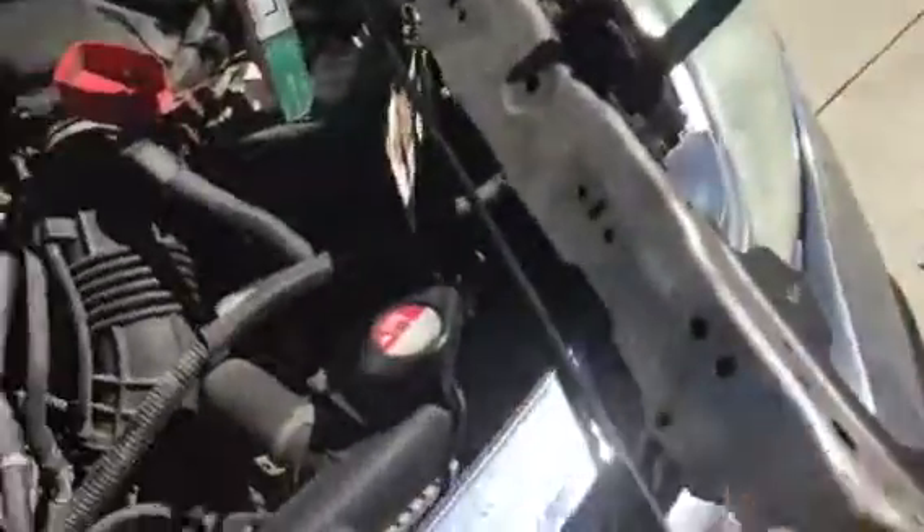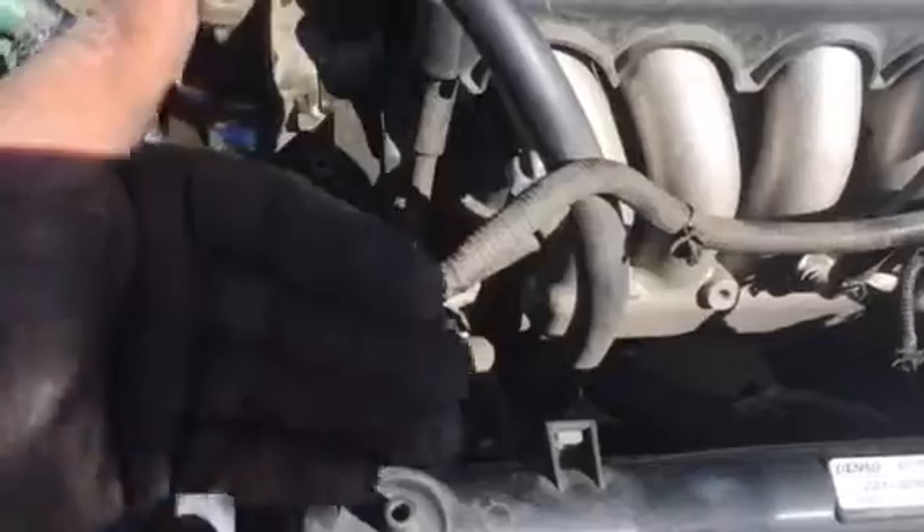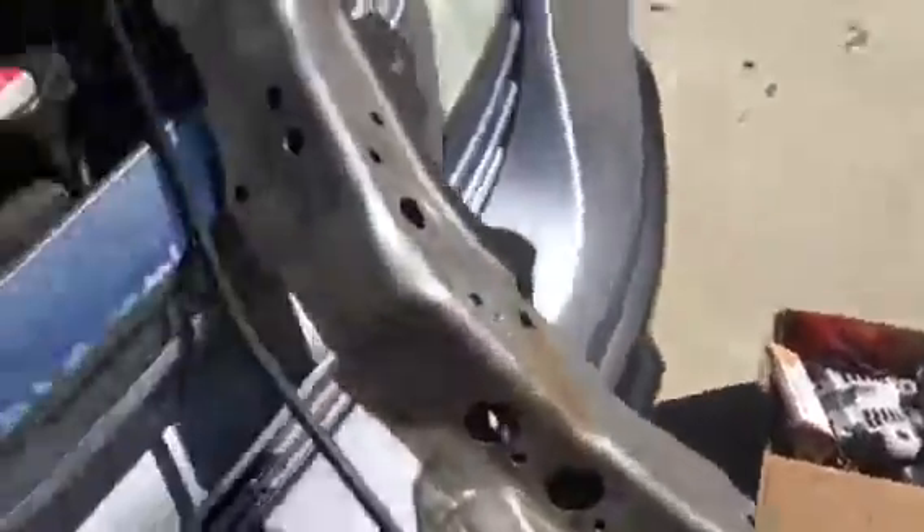Then you have to remove that covered plastic, so you can remove this part from the radiator. Some mechanics remove the radiator to do that, but I don't because there's a lot of space. When you remove this part, you have to remove the fan. The hose is still connected, so you don't have to spill oil or coolant on the floor.